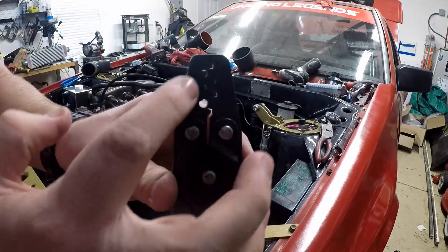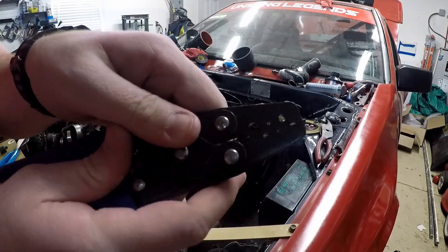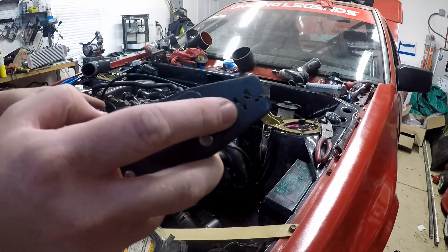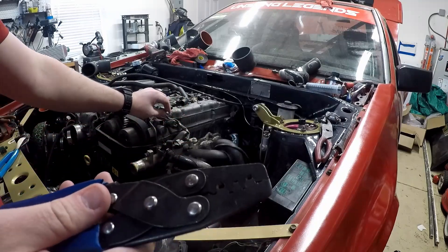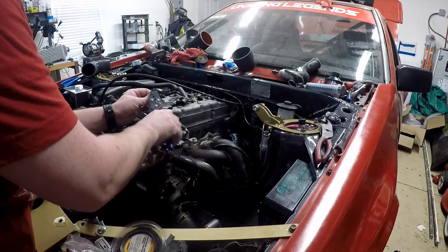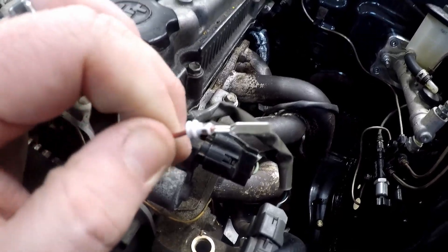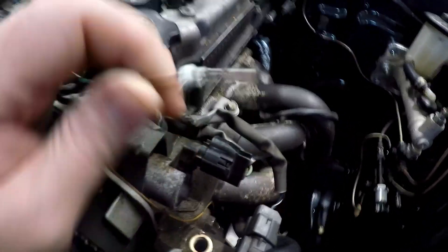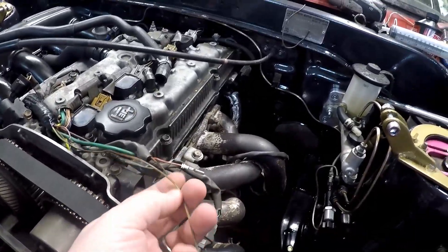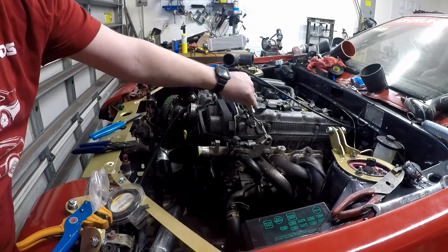On the crimper you've got two different styles. You've got this one that's got like a little V — almost a little dimple — that's for where you crimp it into the wire. And then the other, this big round one, is for crimping the weather seal. You can do that three times. Here's the extra wire I ran to go to the gauge, and I'll show you where this gets wired to. All three of the wires with the pins crimped on with the weather seal.